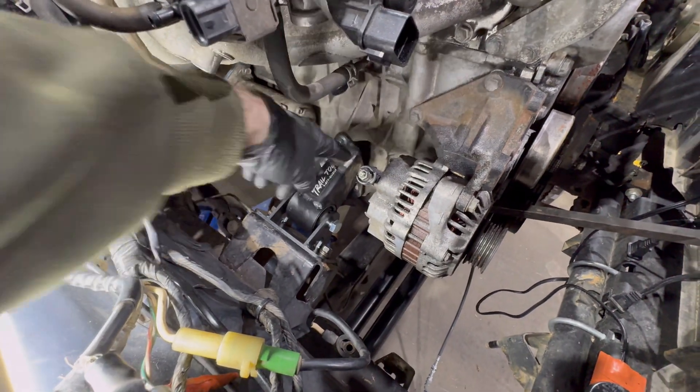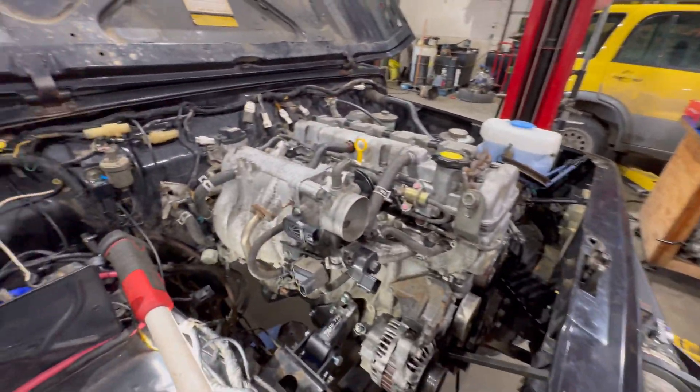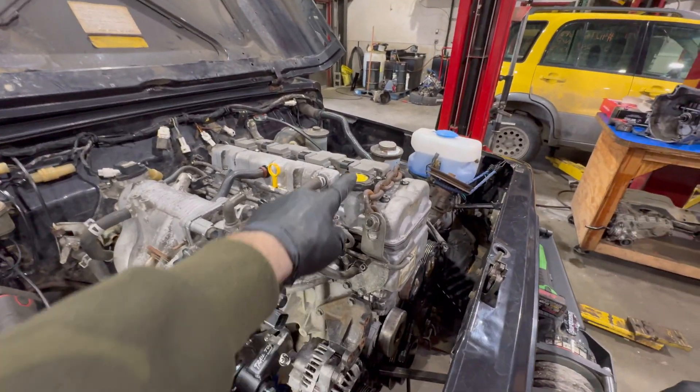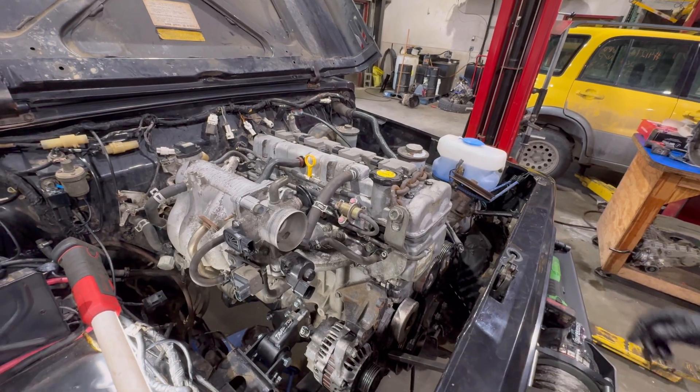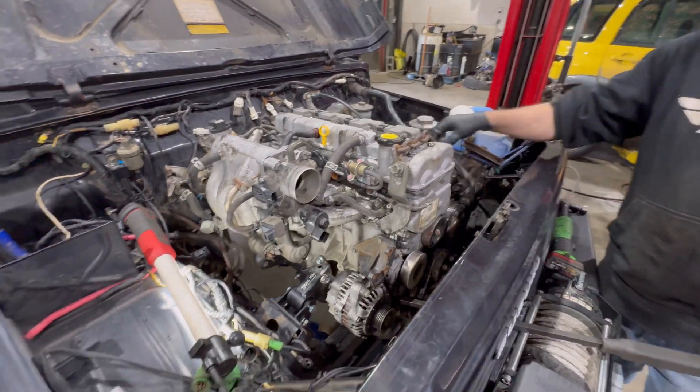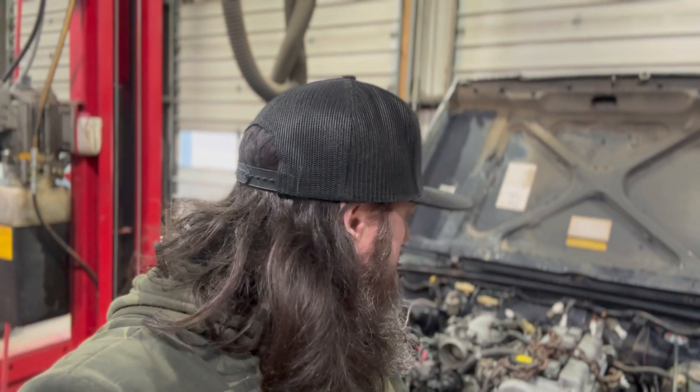We cut that mount and had to put a little jog in there so that bolt would fit, but I moved the mount down about one inch and re-welded it and everything clears. We used a pry bar and rocked the engine with a light under there — nothing's touching. The only thing that touches at an extreme angle is the oil cap. That was a big hurdle to overcome. We did one side, dropped it down one inch, and if you're doing this swap you might have to do this too — mock it up and see if your hood closes. It actually straightened the engine out a little bit more because it was cocked to one side.